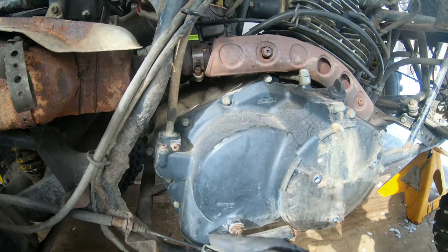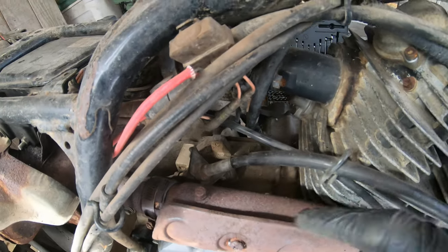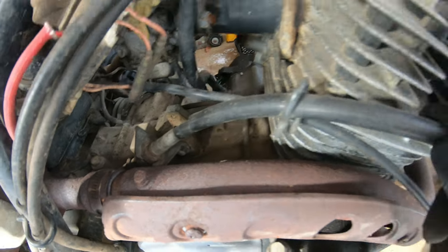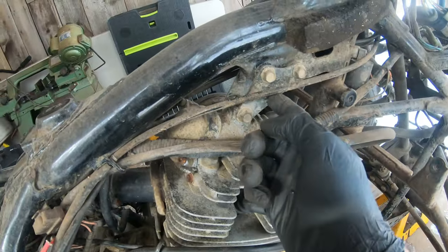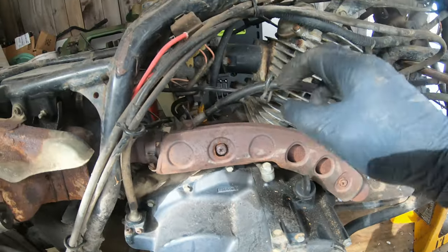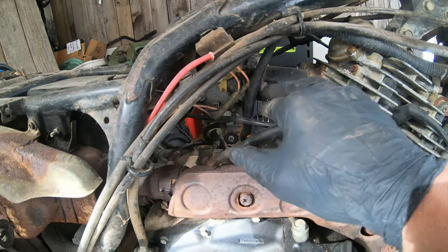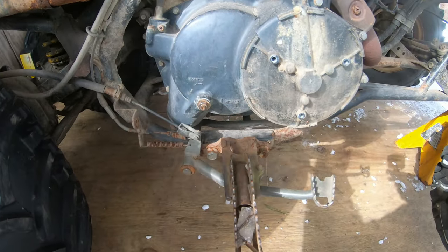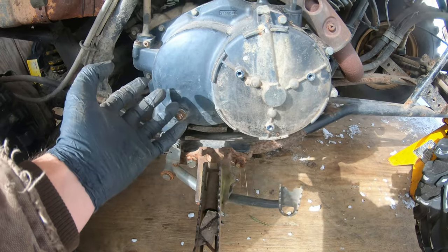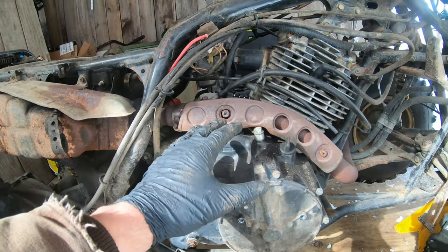To take this motor out, this is your speedo cable - as you loosen it, this should lift out. This is the high-low reverse range. Take off your engine stabilization bracket up here. Undo your spark plug. Take your carb off with these bolts - these look to be 10mm bolts. The way I would do this would be to drop this foot peg off and free the motor up to come out this way. This assumes the exhaust would be able to separate so I get that clearance.